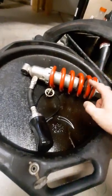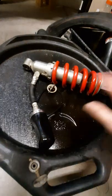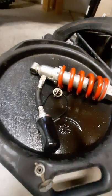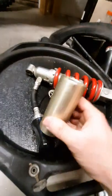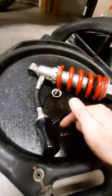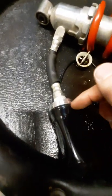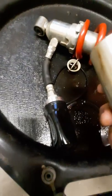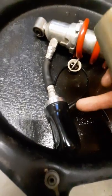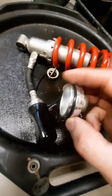To do a full service you're going to have to take this apart completely - springs come off, body gets disassembled, you have to dump the fluid to properly fill and bleed the shock. The spring has to be out to bleed the shock. With this remote reservoir you can use the reservoir to bleed the shock, especially since I'm planning to disable this bladder - I'll probably cut it off right about here. In lieu of finding a suitable o-ring, I'll just trim off the bladder and put a new bladder on a cap that has a Schrader valve on it.